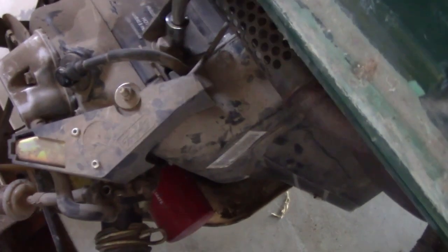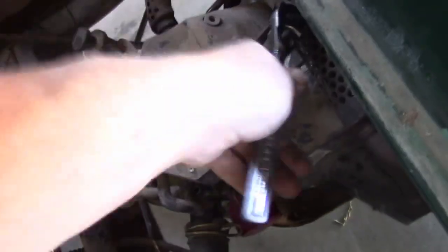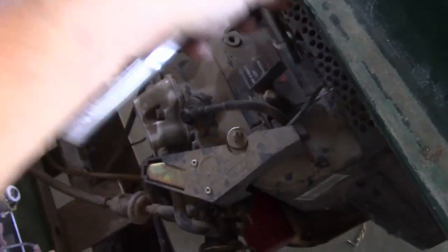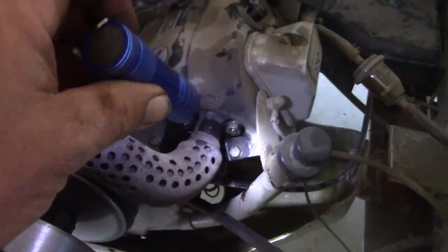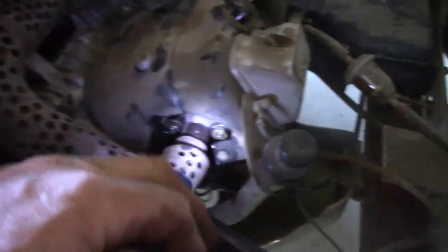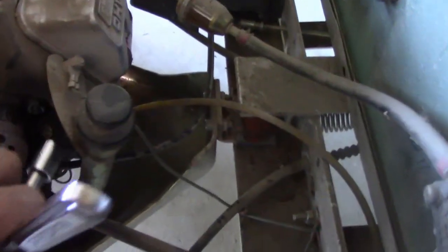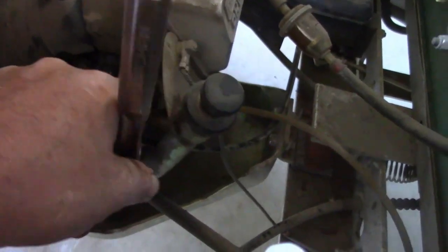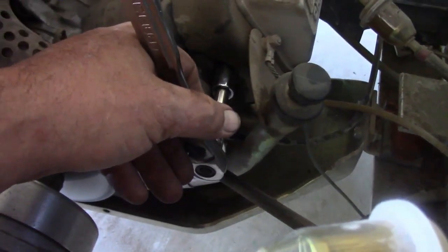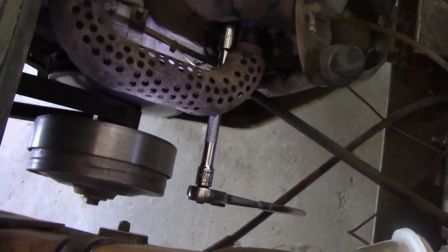You're probably going to have to loosen that hose clamp quite a bit. The bolt holding the exhaust to the top of the engine takes a 13mm socket with a three-inch extension — that's all you need. Next, the nuts holding the exhaust to the engine block itself are also 13mm on studs. On the front side use a 13mm socket with a three-inch extension; on the back side go underneath the exhaust pipe with a six-inch extension.